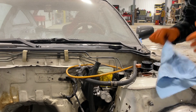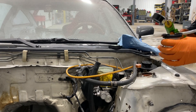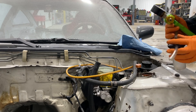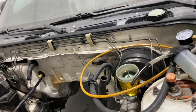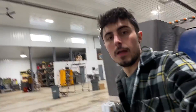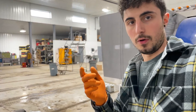Next step you want to do is pull the brake fluid out of the master. I got a vacuum bleeder and I'm just going to use this to suck the fluid out into this reservoir — just helps with not making a mess everywhere. There's this screen that sits right in here, I just turned it with my fingers and it popped up, and you can pull it out just like that.